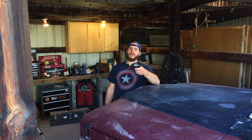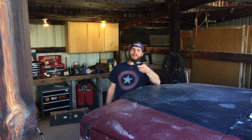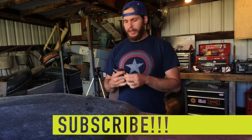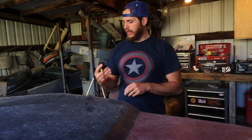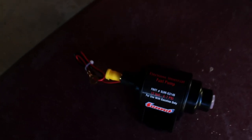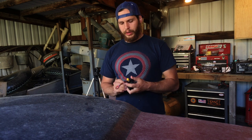On this episode of DPV, we're going to install the Summit Racing electric fuel pump. A while back on my first drive, I had some fuel pump woes. The Holley Red that was on it burned up and left me stranded. Some guys towed me home. I got in contact with Summit to see if I could try out their version of the Holley micro pump. It's an inline fuel pump that runs at 4 to 7 PSI, 35 gallons per hour. That should work pretty good for my application.